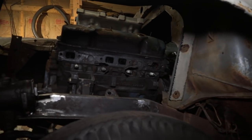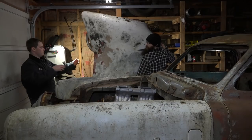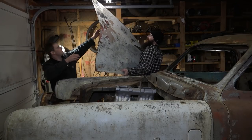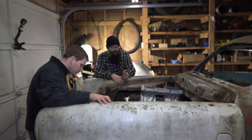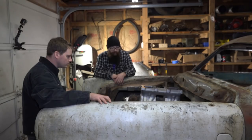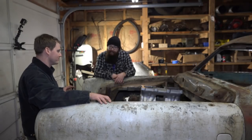It's going to be a lot of work because obviously you can't just buy headers for it. Just out of curiosity, want to see if the hood fits on? Thinking Hilborn-style scoop — something like that. It's pretty tall, a little taller than factory. What most guys like to run on these are the 660 center-squirt carburetors, but they're like $700–$800 a piece. That's almost what you spent on two Studebakers — that would be more than what I paid for the cars.